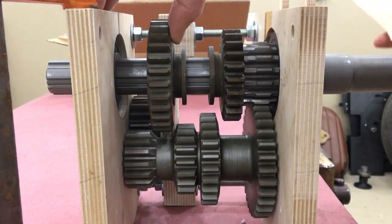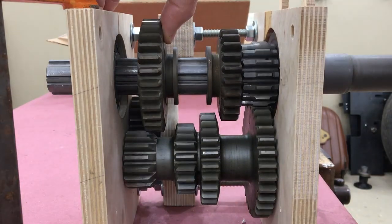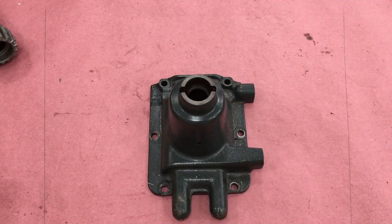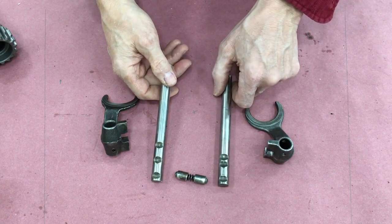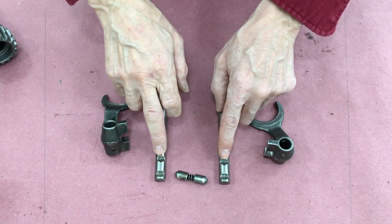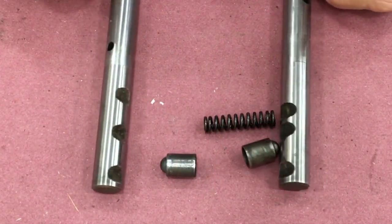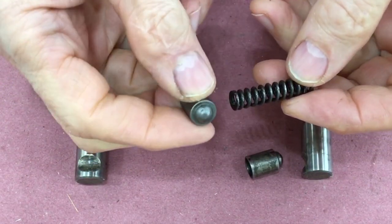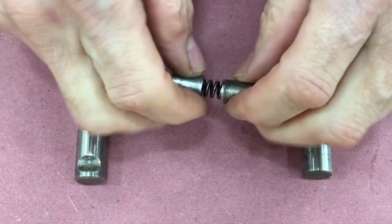You can actually shift the gears by hand — reach down into the top of the transmission and move things around — but that would be a big mess and maybe even dangerous. That's why we have a transmission tower to shift the gears from a safe distance. Here are the internal parts of the transmission tower. These are shift fork shafts and they have cutouts to accommodate the shift plunger. They precisely locate the forks, which in turn precisely locate the slider gears on the main shaft. The shift plungers are spring-loaded inside the casting with a half-circle that engages the shifter shaft.